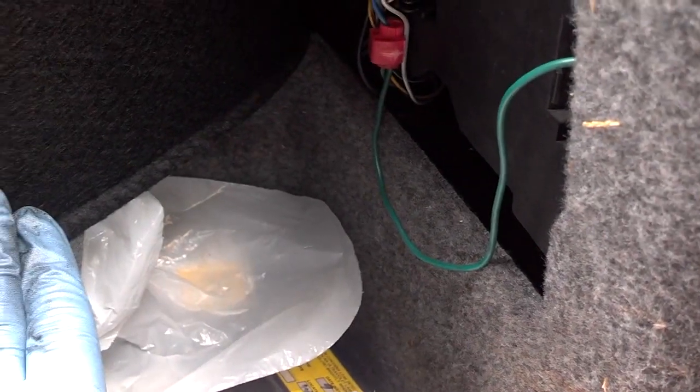Open up the trunk, come on the inside, and you turn these little handles here, and this little panel will pull in, and it looks like somebody's piggybacked something on the light, maybe the tow hitch wiring. At any rate, once you're in here, you reach over here, you pull in the tab, and that unlocks the whole assembly. The whole assembly comes into you here, and then you have access to all of the bulbs.